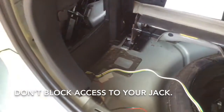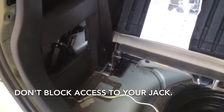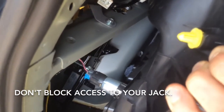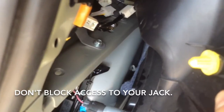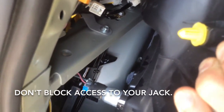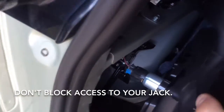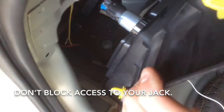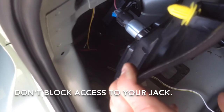You're going to complete the wiring and then move on to running a ground and the power lead. Now while in here I noticed that there are a couple good opportunities for ground. You can see there's one right there. There's a proper chassis ground that's available. There's also that speaker bracket that might be an alternative. So we'll have a look at that in terms of cable length, and you can see, maybe you can't because of the contrast, but the controller is sitting right down in there for the time being.